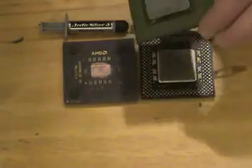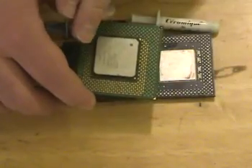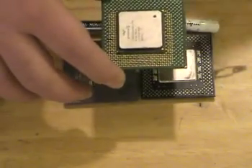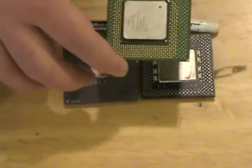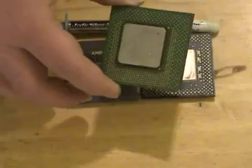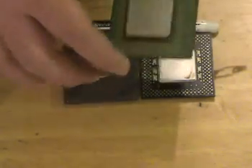What lapping is: you take a CPU and grind the surface flat, because there are actually little divots and normally a bit of a ravine to it, and that decreases the thermal paste's ability to conduct heat properly. Now, you can lap it, but you have to realize that as you're lapping it, you're generating heat. You could also generate static electricity and fry the CPU, making it worthless — a keychain. Not worth it in my opinion, but it can be done and there's a whole procedure for it. I'll put up information in the show notes.